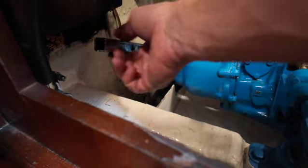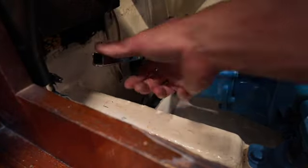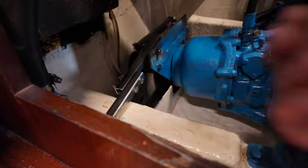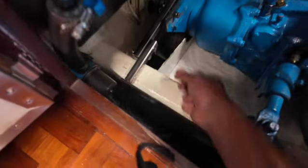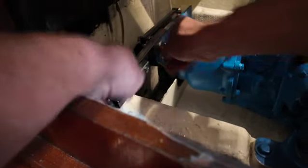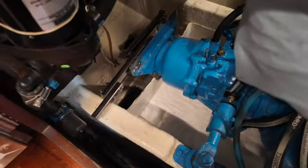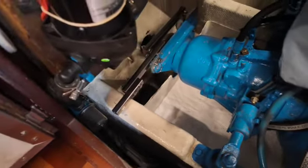I added this little section because this has to clear the little fire extinguisher pocket there. And then I also wanted a little bit extra leverage just in case. And this little bit helps stop it from looping all the way back around also. So that's there. Makes it uglier, but it works. And then that cotter pin sticks in there, and that will keep the shaft braked. So I'll call it a success for now. We haven't tried it yet, but I like it so far.